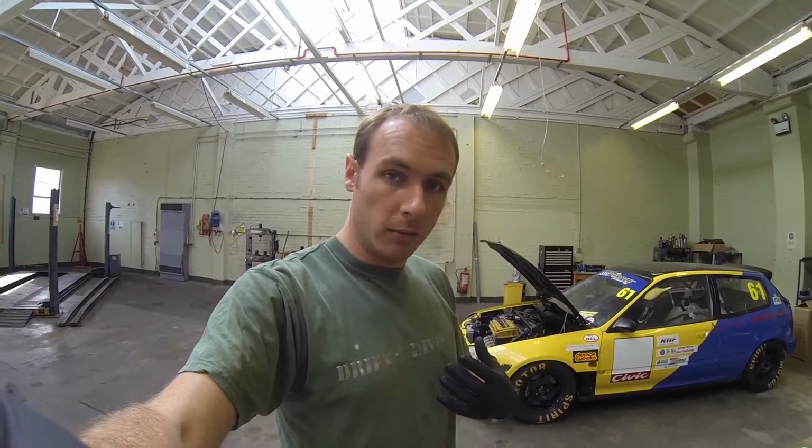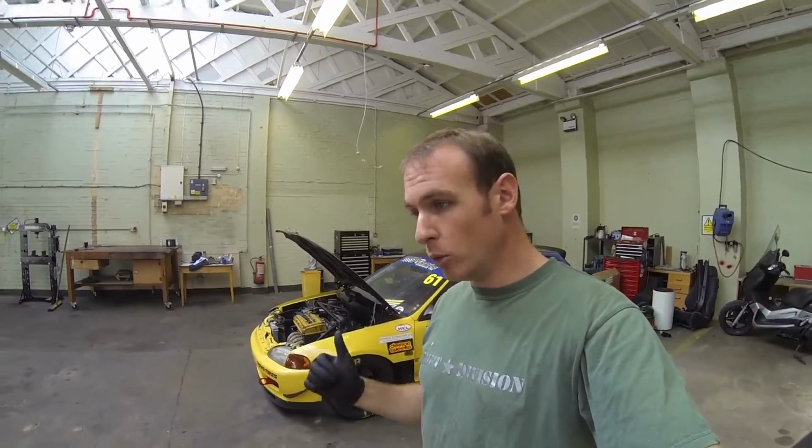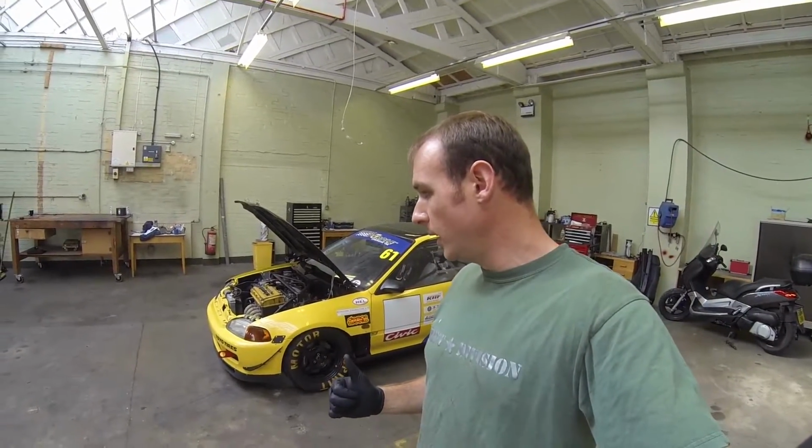Obviously I need to be in the car when I take my measurements. Now, that's the car set. Obviously I've got the scales, I'm going to pull them out in a minute. The scales need to be perfectly level across all four, so individually, and I'll show you how to do it with a plank of wood and a spirit level across all four scales, to make sure that's nice and level, because if it's biased or if it's leant over one way or the other, then you're going to get a slightly off reading, because it's all about the weight of the car.